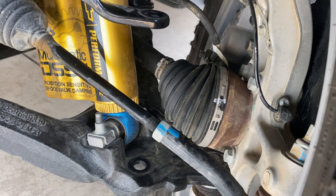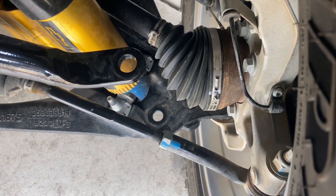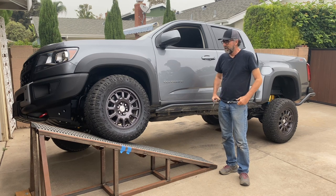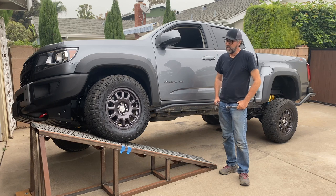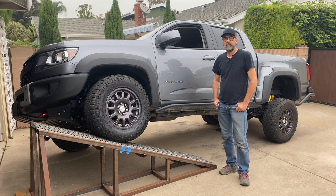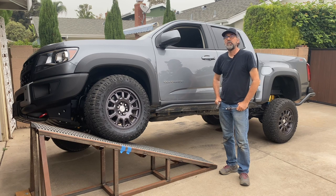Also, the stabilizer bar is just flopping around in there right now and could start making contact with important pieces if you don't lash it into position. It might feel like the bushings are stiff and it won't move, but trust me — bouncing around off-road, it will. Finally, this truck has two locking differentials and a good traction control system, so the extra flex you get here, you probably wouldn't notice the difference because you have those features to get you through the rough stuff. Just not enough of a flex index improvement to be worth it. Anyway, that's my opinion — let me know yours in the comments below, and like, subscribe, share with your friends. I'm going to put these things back on and go drive this sucker.